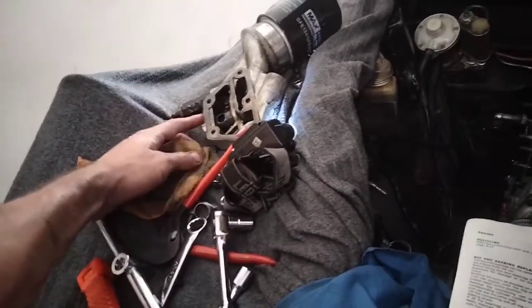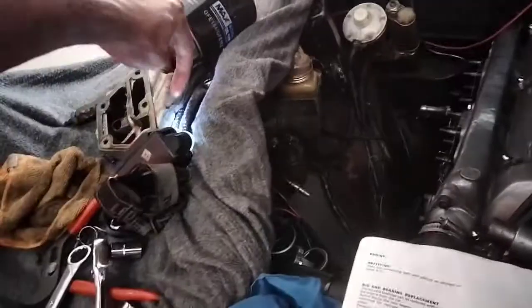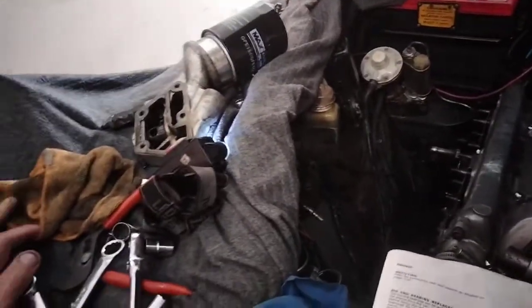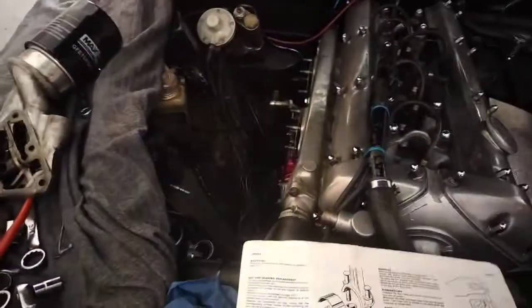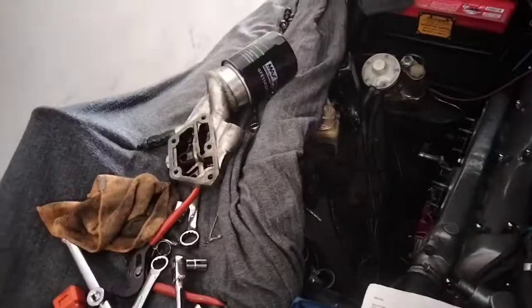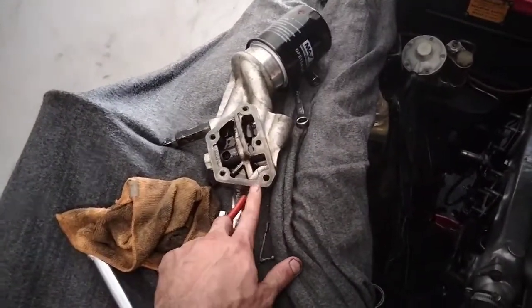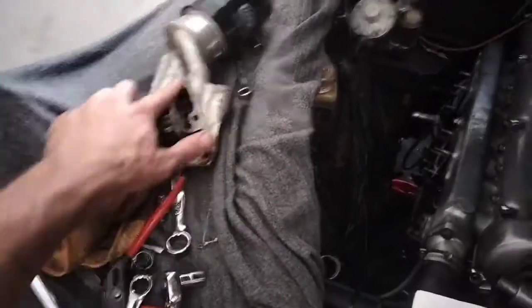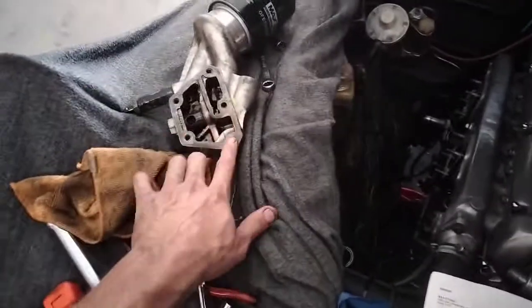That's why I was scratching my head when I pulled the balance valve, which is what I thought it was — this is fine. Then I got back to Brisbane and started playing around with it a little bit more, and realised it's actually in that little transfer pipe back into the sump. I just want to show you what an absolute mission it was to get that off. As they say, a one two-hour job is only a broken bolt away from being a ten-day ordeal. I didn't break the bolt. You can tell someone's had a go at it before — all four bolts, but this one here was very dirty and hadn't been touched in a long time.